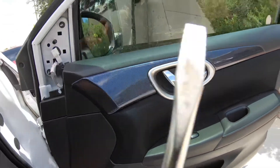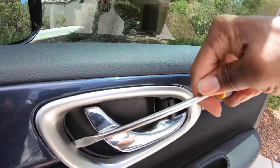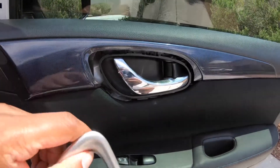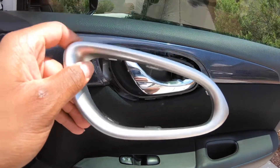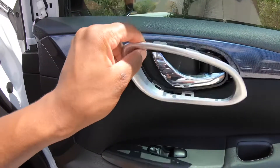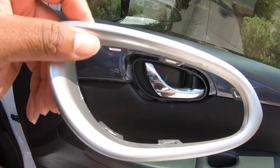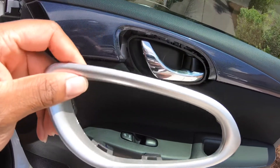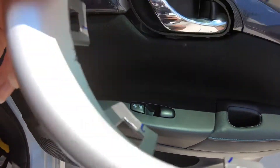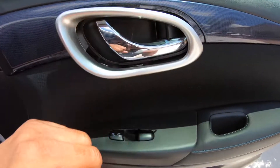It's heating up out here. Okay so I got the door ring off. Like I said, you pry it out and then pull it out with your hand - but you actually can't pull from the outside because it's held in by clips that are on the inside. So trying to pry it from the outside won't help. Use a pry tool or a butter knife - not a flathead screwdriver because it's too thick. Position the butter knife near the clamp areas right here and it'll come out super easy.